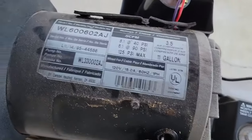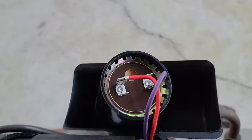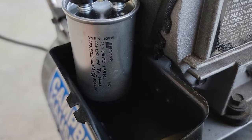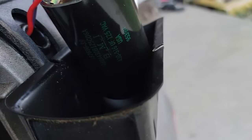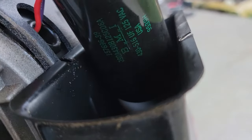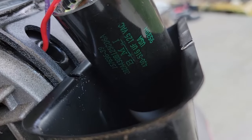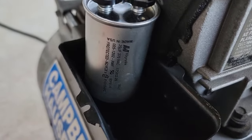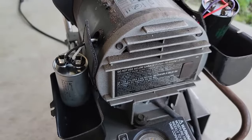It has these compartments on the side that look like they both house capacitors — one's a funky style and the other is a more traditional capacitor. I'm going to take pictures of the specifications: this one's 25 microfarads, 370 volts AC. The other one has markings reading 430 to 516 microfarads, 125 volts AC. Both have part numbers, but these are pretty generic capacitors, so I'm going to look them up online on Amazon or Grainger, replace them both, and see if that fixes the problem.